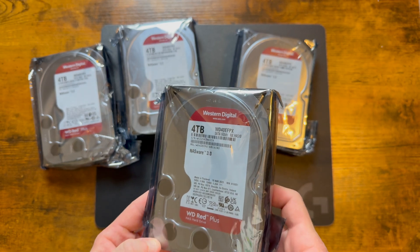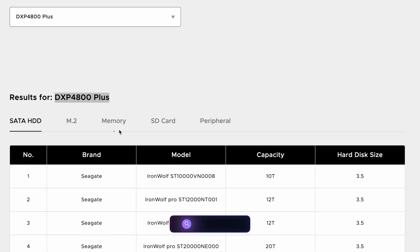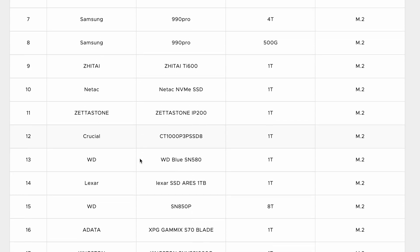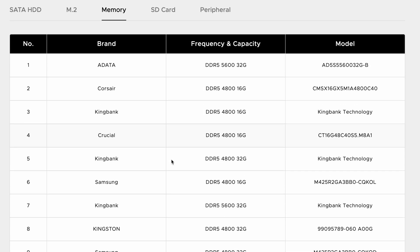I'm currently using four 4TB Western Digital drives in my NAS in a RAID 5 setup. Meaning if one drive fails, all I do is unplug it, put in a new drive, and the remaining three drives will rebuild what the fourth drive lost. What I also like is that Ugreen doesn't lock down their NAS to specific drives. They have a huge list of compatible drives, as well as a RAM list and M.2 SSD list if you ever want to upgrade. I'm actually planning on getting 16 gigs of RAM to replace the built-in 8 gigabytes. You can pick and choose which company and storage you want — it's all very user-friendly. You don't have to be a scientist to figure this out.